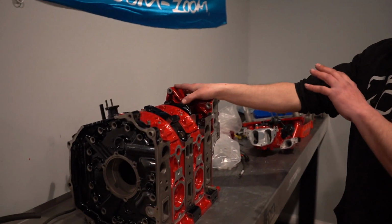Now, we are working to do a Haltech patch harness setup, so that we can tune these on the Haltech ECU as well. Now that will be true flex fuel. You can do whatever you want, you can go back and forth with that. That is only really going to change timing, really, and then also our heat thresholds on the exhaust. So there will be EGTs hooked in, and there will be safeties for the temp on the exhaust.